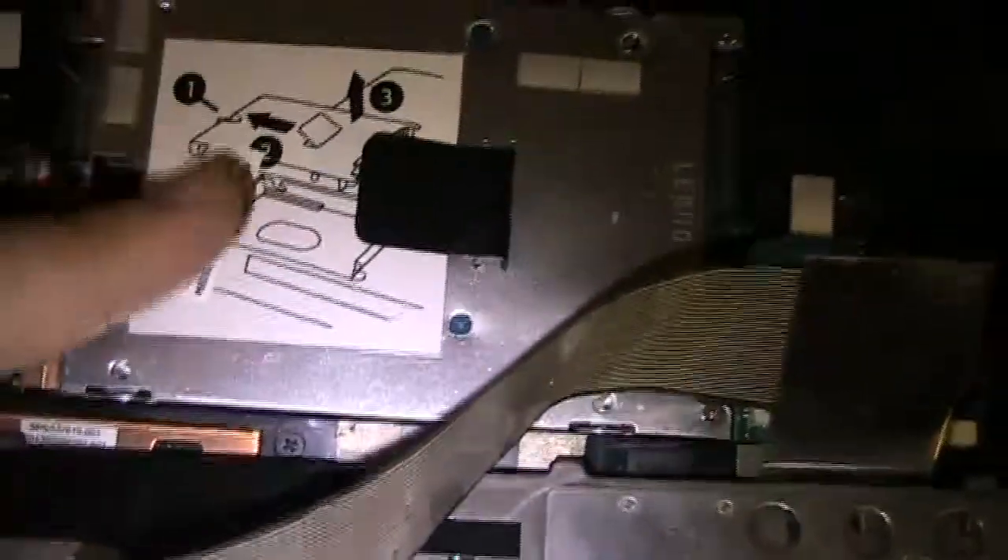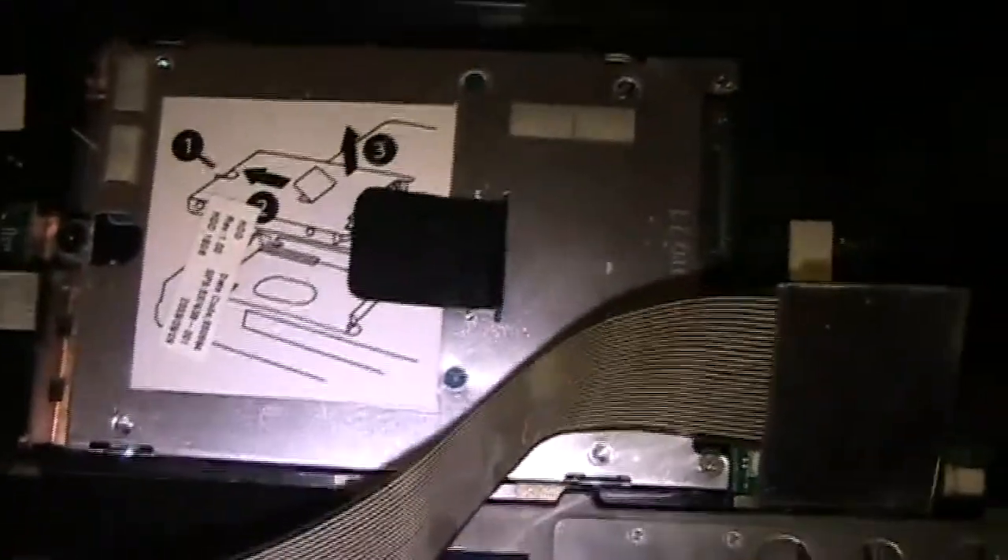Here's the hard drive. What I did was replace the 16GB solid-state drive. They had it mounted to a caddy, except it was one of those teeny little mini SATA things. Not only did they have four screws in it, they were four screws that were riveted. You could not remove it — those seams on the other side of the screw where you just keep turning and turning but it doesn't come out because on the other side it's a rivet.